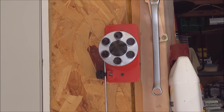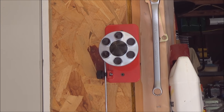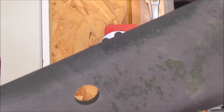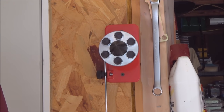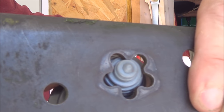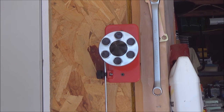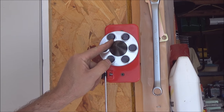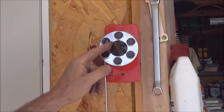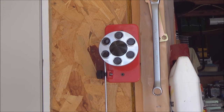Now for a very important part of blade maintenance — the actual balancing. Especially if you have one of these newer types with a star center, the old famous method of pounding a nail on the wall doesn't work so well. There's a simple balancer you can find at any home center for $5 or less, but that thing's kind of hard to center in there. I found this one on Amazon for around $100 — it's an Italian-made one, also available with an Oregon part number. This is the type you'd find in a pro mower shop, and it's well worth it to me.